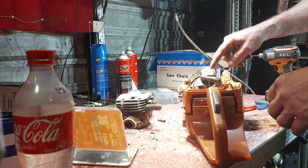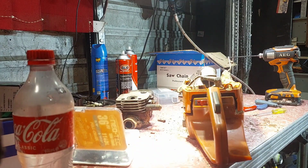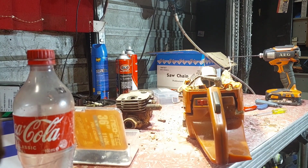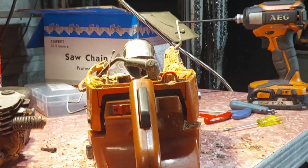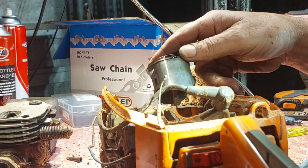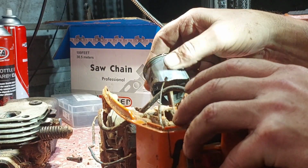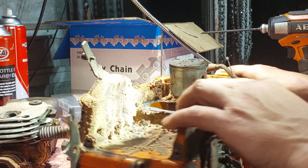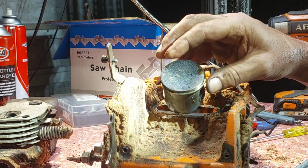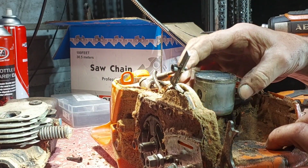Nothing wrong with the crank. The piston has a bit of wear on it. I'm charging my phone, guys. It's hard to do this without moving your ring, so I'll zoom you in. I'll put you where I can get a view on the piston. That's the intake side of the piston, so it's shiny, but dirt and dust has been getting in. That's alright. There's a lot of carbon build up in the cylinder, quite a bit actually. The exhaust side has wear, but it's alright.